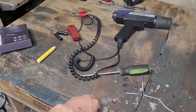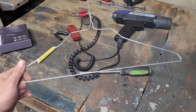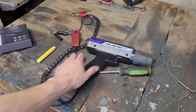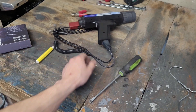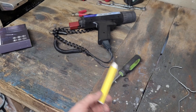The tools we're going to use are a metal coat hanger — this is what we're going to fashion our timing pointer out of. You're going to need a timing light; this is just a Harbor Freight special, nothing too expensive, about $30. You're also going to need a marker of some sort. I like to use these grease pencils for tires — they're easy to see on the balancer.